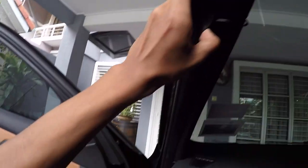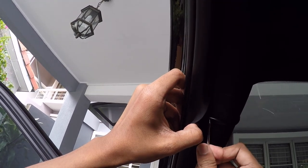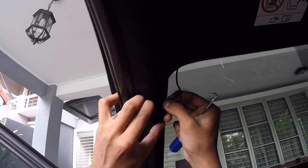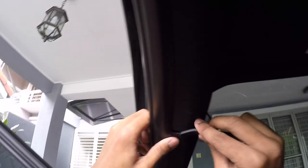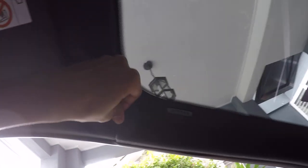For this part you will need your pick tool again. You would lift the weather shield all the way up until you can pull the A pillar down. All you have to do is make sure to get a good grip of it, and you'll be able to shove your wire all the way through. Once you've got it in, make sure your A pillar is back in place, then route these cables back up and take your pry tool again.